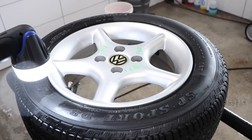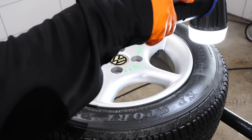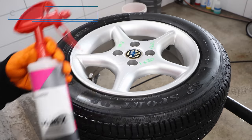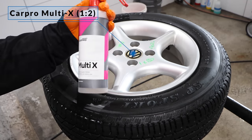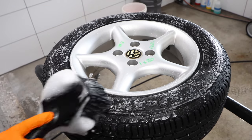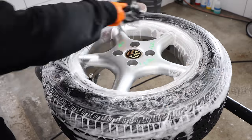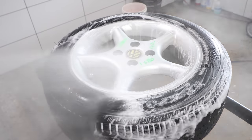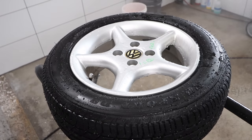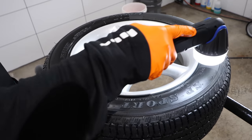down this tyre coating. To cut a long story short, I just gave up in the end. No matter what I used or how aggressively I used it, I just couldn't remove or barely break down this coating. And as you'll see, I even used turpentine in the end, which is quite an aggressive solvent-based cleaner that I don't particularly recommend you use on tyres, as it is quite aggressive on rubber. But even then, that wasn't able to remove Blackout either. Maybe it did slightly start to compromise it and knock down its gloss, but it would probably take a dozen applications to get it off.